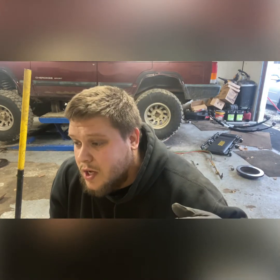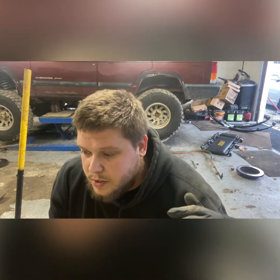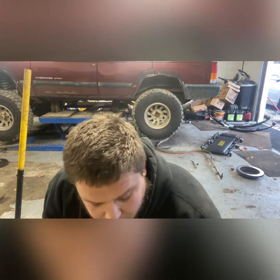As you've probably seen, I got the rear bolts worked out — the nuts off anyway. Passenger side, bolts already coming out, no problem. Driver side she's wanting to stick a little bit — I might have to get a little meaner with the torch. We're going to soak it down with some Lubidooby and work on the front bolts because everything where the axle is is all brand new and I'm pretty sure I greased it when I put it together, so that should be fine.